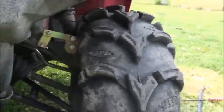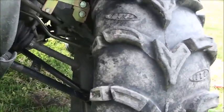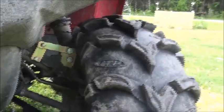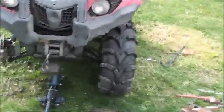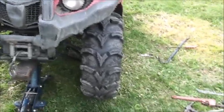Well, this is a little disappointing. I can't put these wider tires from the other quad on this one. I guess with this lift now, see, it's sitting right there. So the same small tires have got to go back on, because those ones are 10s on the front and the originals are only 8. See, these 10s just clear there, but when you put a lift on, they don't clear anymore. So yeah, I guess I've got to take this little guy off and put it back on there. Look funny, great big high quad and little tiny tires. Well, I'll have to get some spacers after now.